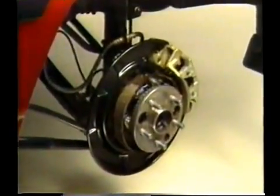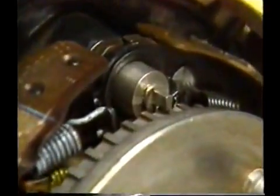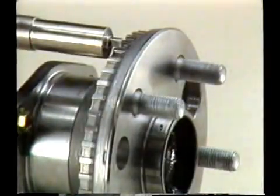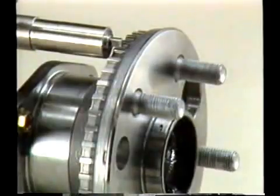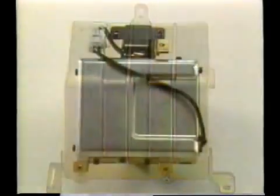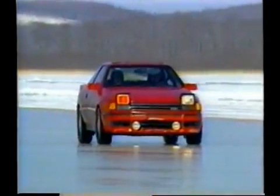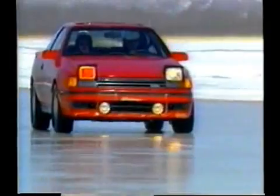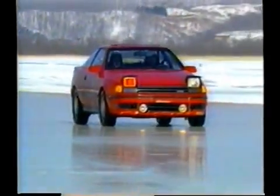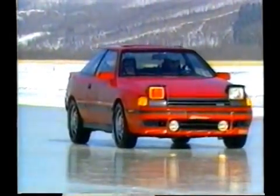Each rear speed sensor is fixed to a parking brake plate, and a serrated rotor is provided on each rear axle hub. This is the deceleration sensor used on four-wheel drive vehicles. Unlike the front-wheel drive vehicle on which the rear wheels are not driven, the four-wheel drive vehicle has special characteristics during braking because all four wheels are being driven. For this reason, a deceleration sensor is provided to detect vehicle deceleration.